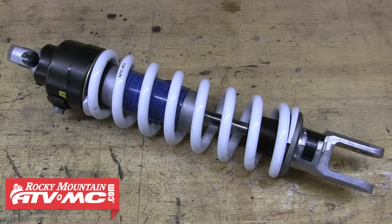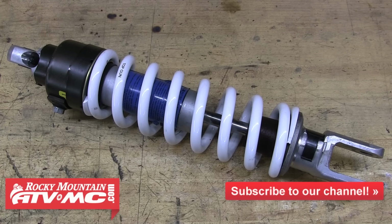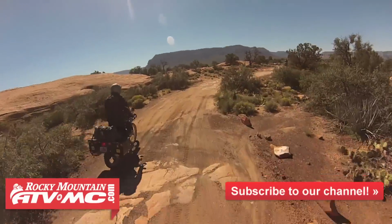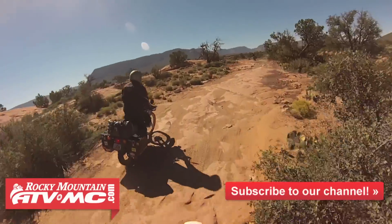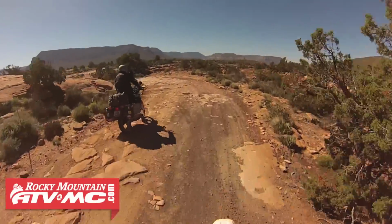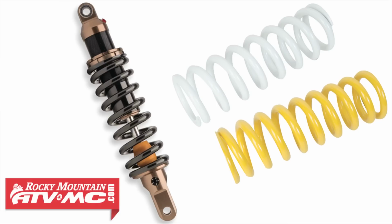We chose to upgrade the spring on this shock while we have it apart. This is a common upgrade for these bikes, as most people that ride a KLR650 find that the stock spring is too soft. If you're a heavier rider or plan on running panniers or additional gear or luggage, upgrading to a heavier spring is highly recommended. And Rocky Mountain has a few different options to choose from.